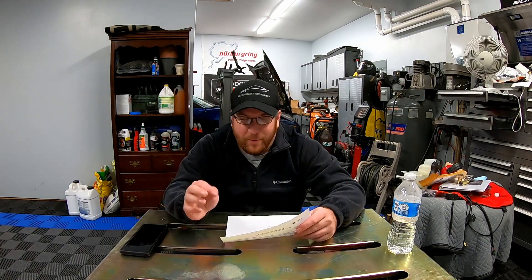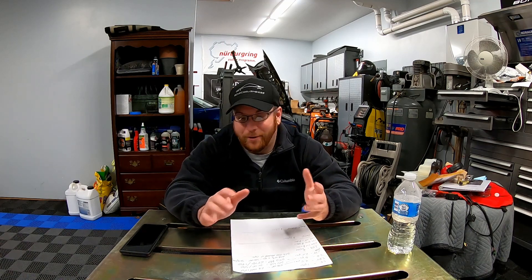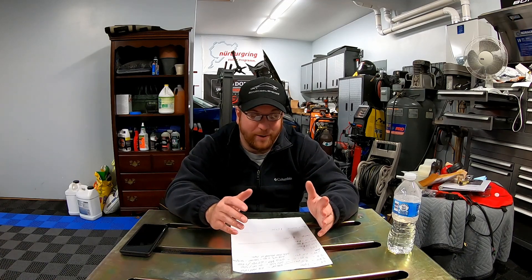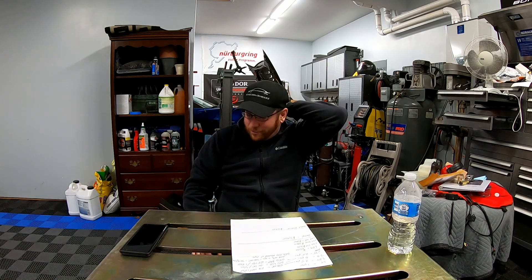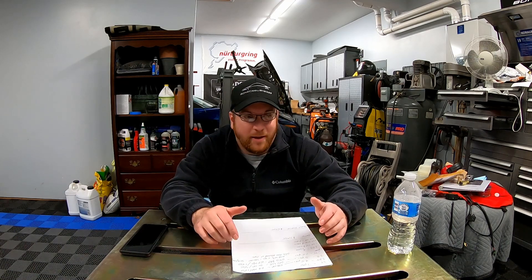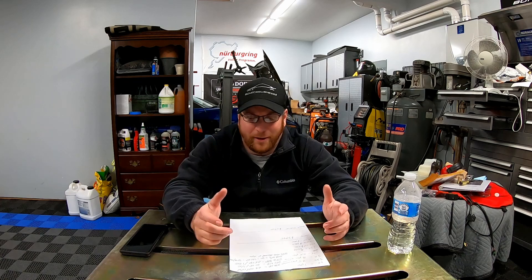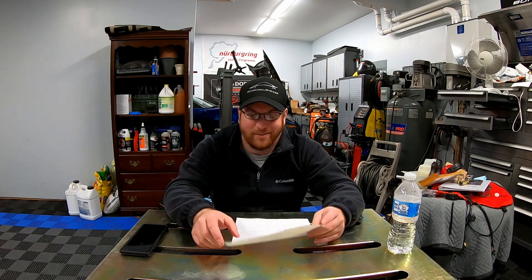Now let's talk about the 2650 numbers. I've already seen RPM's videos, other people's dyno videos, and Harrop's videos. Basically, with a 400-plus cubic inch motor — whether it's a 416 or a 427 — these cars can make well over a thousand horsepower, up to around 1,100. Harrop even did a 102mm throttle body with a big pulley LSA setup and made around 1,200 horsepower. RPM's most recent video was just over 1,020 horsepower.